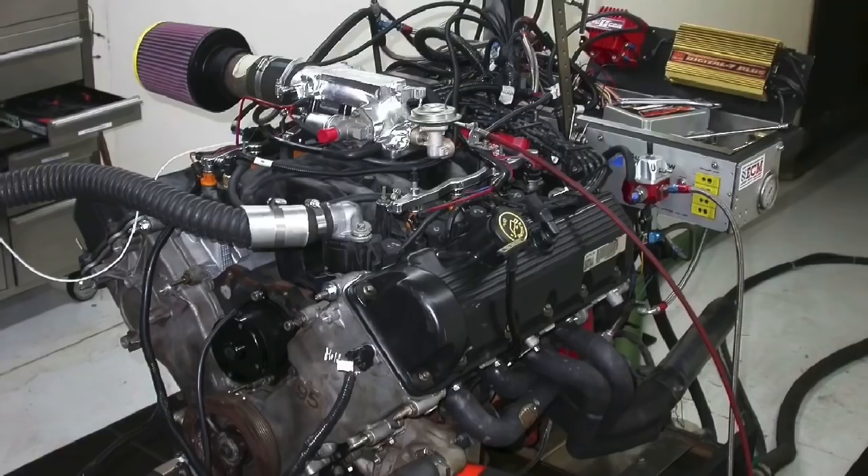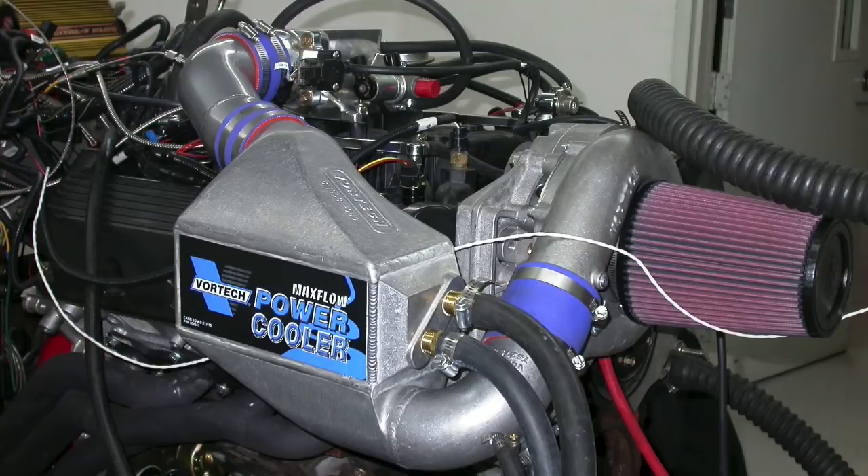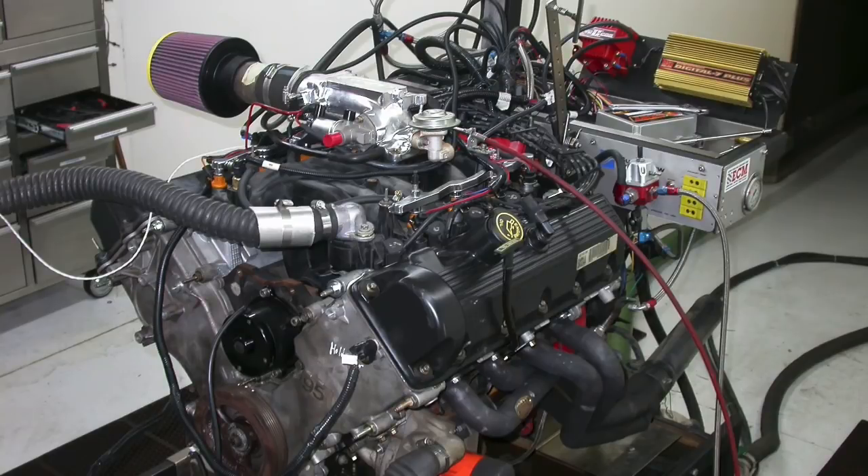Our takeaway from all this testing with the 4.6 two-valve: because Ford offered the four-valve, then the three-valve, then the Coyote, and because the LS motor exists, the 4.6 two-valve Ford has gotten a bad rap — but personally I like the motor. Like everything else, because Ford made millions of them, they respond well to upgrades: ported heads, camshafts, intake manifolds, and obviously boost. This test shows that if you add cam timing and it makes more power NA, it will definitely also make more power under boost — and you'll decrease the boost, both of which are good things. Cams, springs, and boost. Make sure to like, share, subscribe, ring the bell, and check out those playlists.